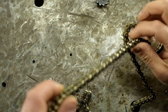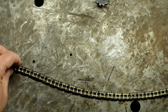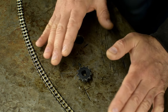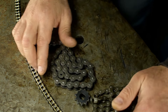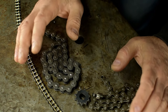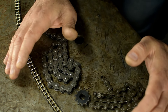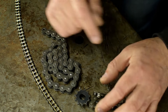The chain is shot - chains should not bend this way, not this much at any rate. The parts manual for the bike says absolutely nothing; it just lists chain and the two sprockets. The dealership couldn't help either - they say they just sell the chains or sprockets or the whole kit. My plan was to make my own drive sprocket, but that's hard to do if I don't know what size chain I'm dealing with. Long story short, I ordered all new parts in 219 size. The rear sprocket on the bike still looks good, but since I can't figure out the original size, I'm just going to change all three.